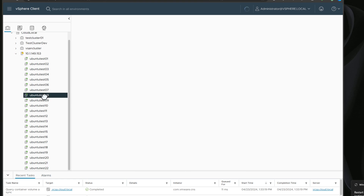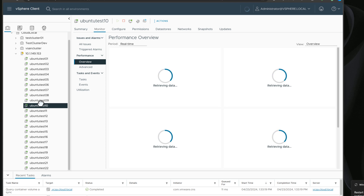Let's talk about power consumption — a critical factor when running a home lab 24/7/365 where efficiency is very important alongside performance. The TrigKey S7 Pro really shines here with a surprisingly low power draw. During my tests, the S7 Pro was observed idling at around 9 to 10 watts, which is quite modest for a device of its capabilities. This low power consumption is ideal for users planning to run this unit as a home server 24 hours a day, with significant cost savings over time.